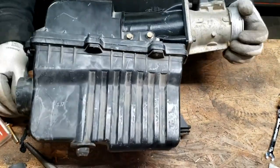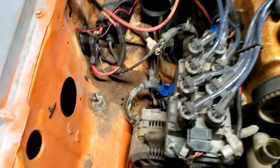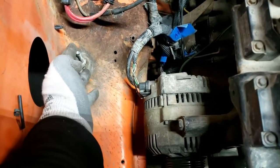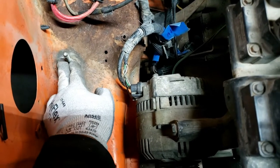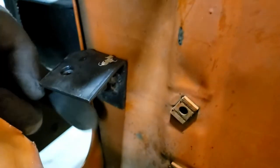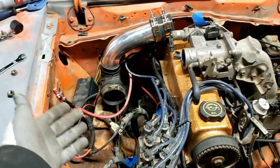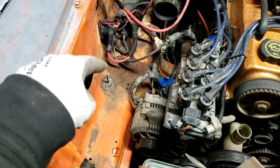To mount the airbox in the car I needed at least two mounting points. I very crudely welded a bolt standing straight up here — it's a little bit low, so I put another nut on there to space it correctly and tighten it down. At the front I built a little L-bracket with a captive nut on the side and one on the bottom, then drilled a hole through the fender apron and bolted it from inside the fender well, so it's nice and secure with a bolt going in from the top.